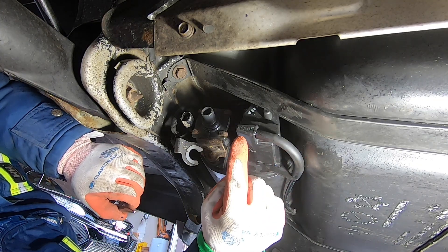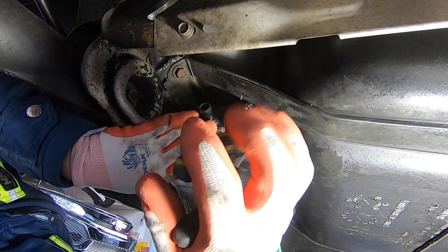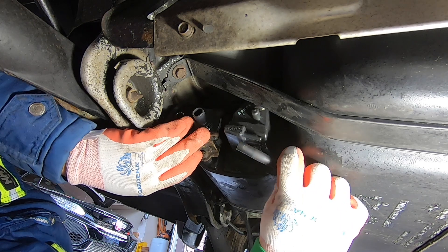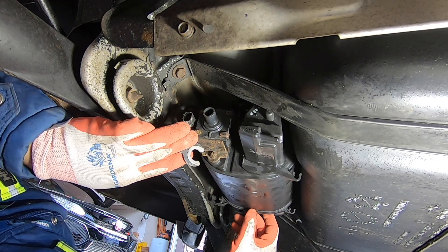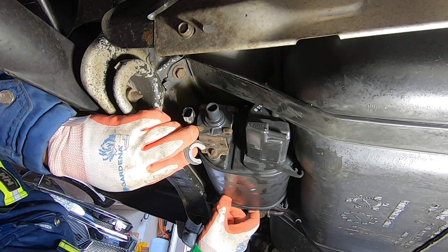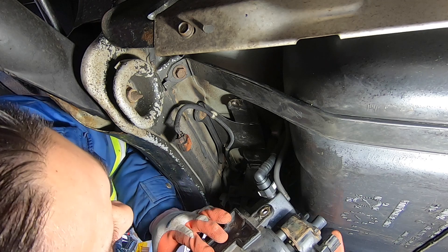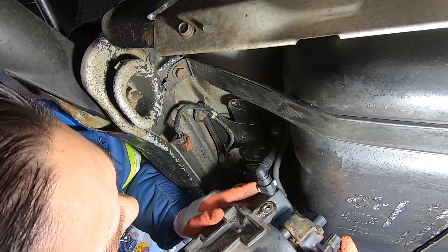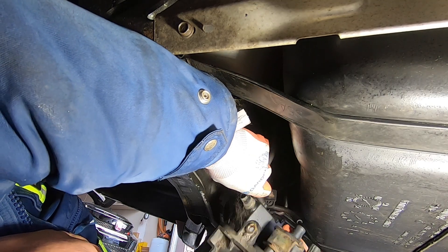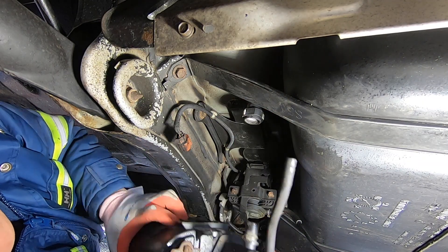We need to take off this hose because this solenoid piece on the back side of the canister is not attached to the can. Break the seal, pull, and then unhook it off the little brackets on the can. To take the can out there's a little hanging hook that goes into the back of the canister — you just have to tip it down and forward towards you and the whole thing should come out. The last hose that has to come off is this big one right here — squeeze the little tabs and it pops right off, unlocking from the nipple piece.